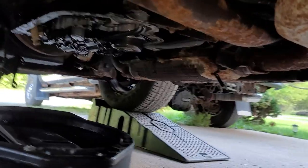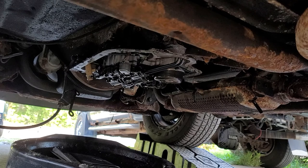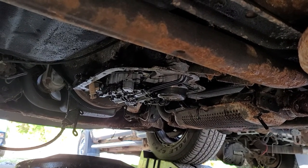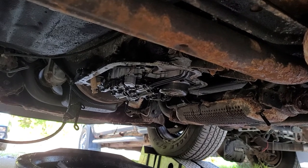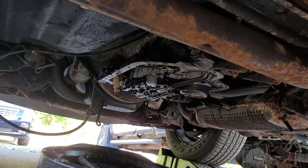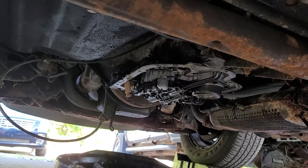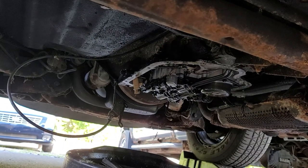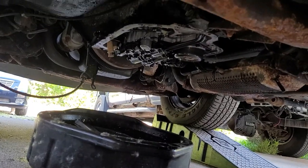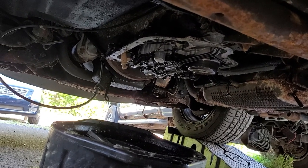The story was, my uncle and my grandpa, when they first got this car, took it up to a truck stop nearby, and by the time they got two-thirds of the way back it started slipping. They'd added tranny fluid before they left. Grandpa thought maybe there was a hole in the pan, but I don't see a hole in the pan — it's not rusty and doesn't look beat to death. I think maybe this thing's got a torque converter draining-back issue.